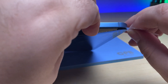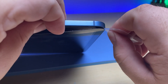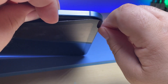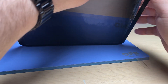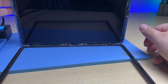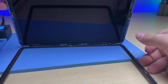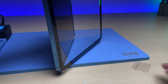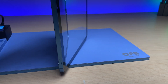Now in doing it this way, especially if you're not planning on replacing the digitizer, you can easily separate and retain the original adhesive so that you don't destroy it. From here, you can just let it fall down. I like to leave it on the heat pad so the edge can warm up that adhesive. I'm going to go one more step and just make sure that the adhesive ended up on the digitizer side and not on the frame side by carefully slicing down the edge here.